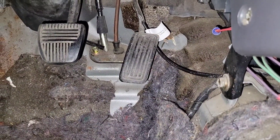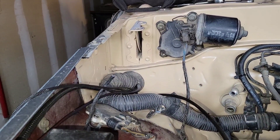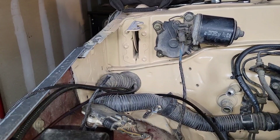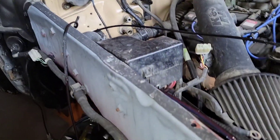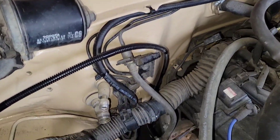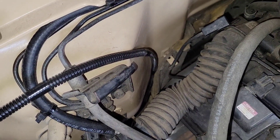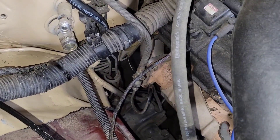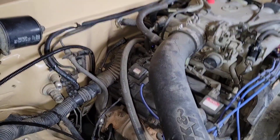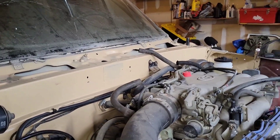OBD2 ran under there for now. There's gonna be a ground wire on the other side that I have to connect. Under the hood, all the wires come out of the main harness — I just cut a little tiny slit for the wires to come through and now I'm gonna put them where they need to go. Got the transfer case and reverse switch ran down in between the firewall and the heat shield so it stays clear of the crossover pipe.